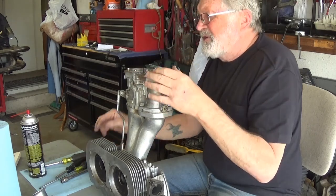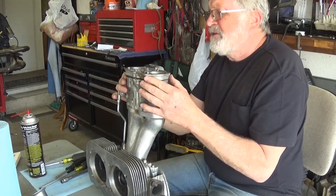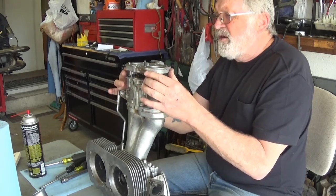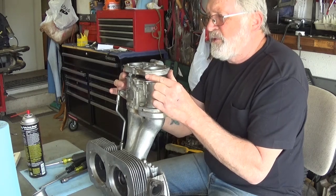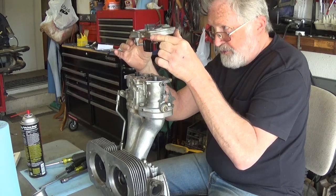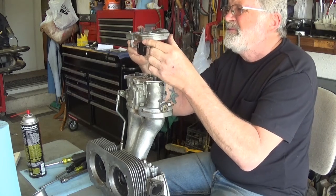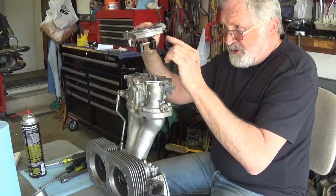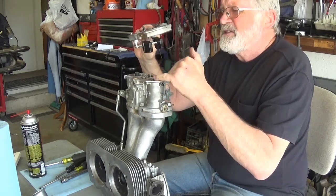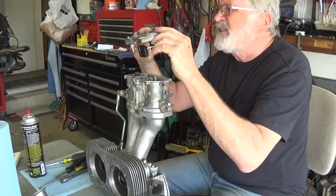And this 2110, for somebody who's just dropping in, tested 148 pounds on cylinders 1, 2, and 4. Now, be extremely careful when you lift this top, because there's another one of those gaskets there, and if you want to take your float off, that's how you tear things. It'll get hung up on screw threads or stick to the body. Some people put a little bit of Vaseline around, or you can put some light grease or something in there. I don't necessarily like to do that.